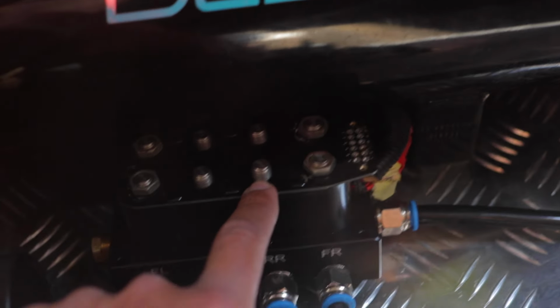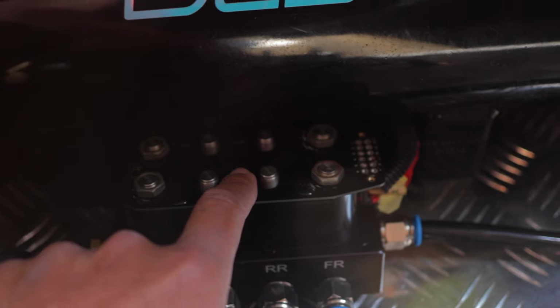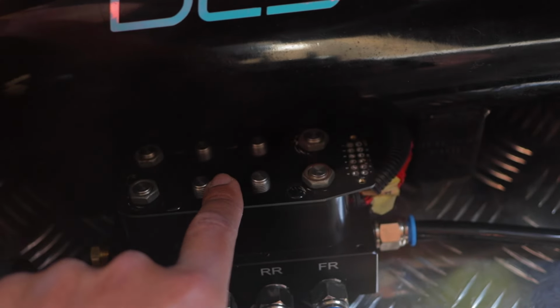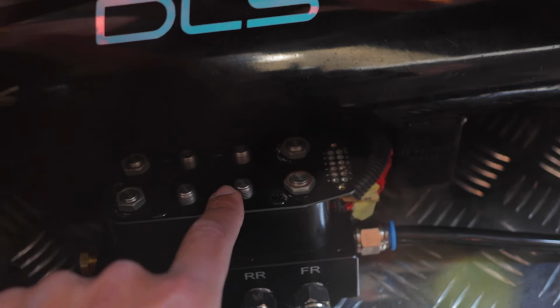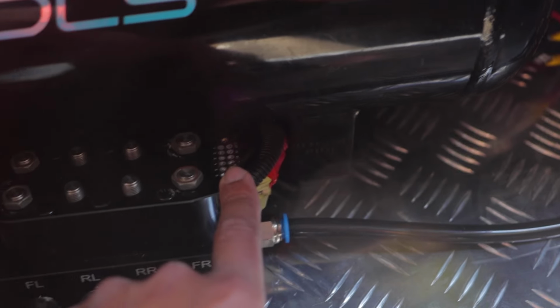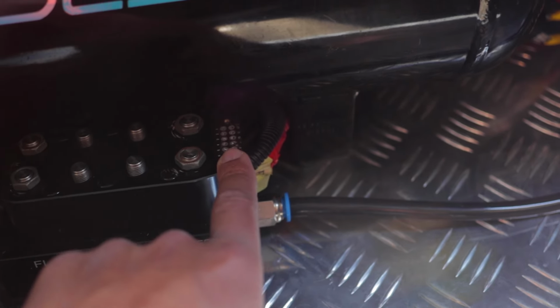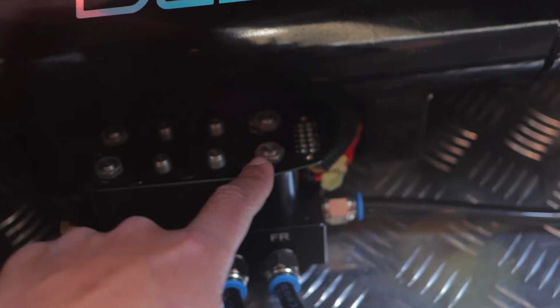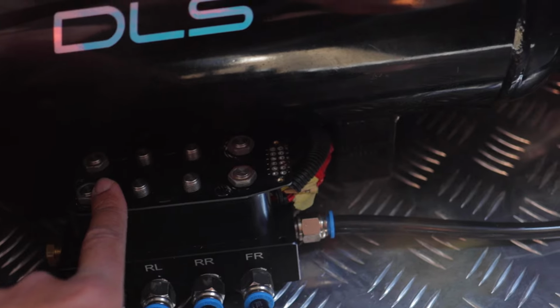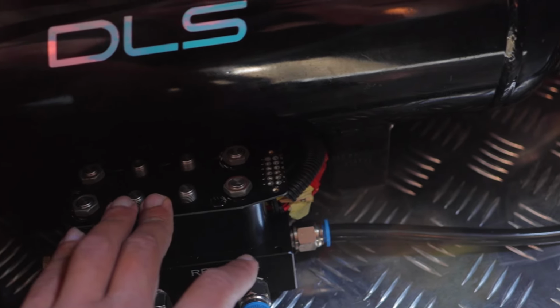So this, as you see, the VU4 block has a circuit board right on top. This plate looks like a cover. There's a circuit board. There's normally a plug where you plug your wires in here. So that circuit board was burnt out. So what I did was I bypassed that and figured out all the wires.